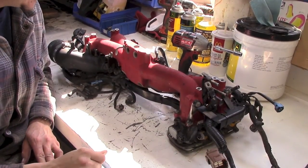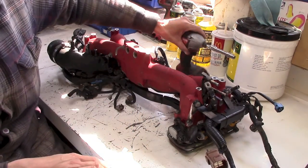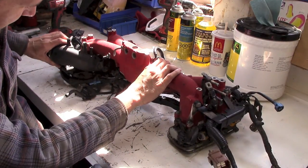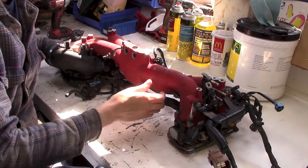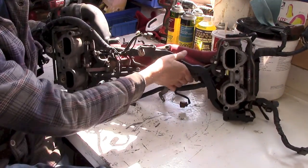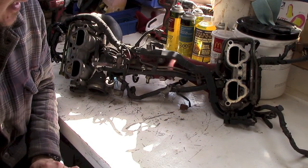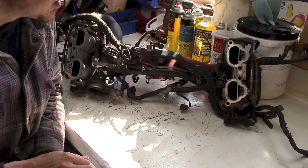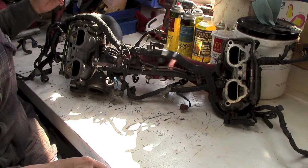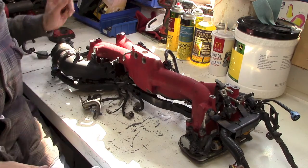But in this sitting, I am going to continue dismantling this because what I need to do is get the tumble generator valves out. Now, if you've been following any of my previous videos, you know that I'm doing a tumble generator valve delete so that I can get rid of my pesky check engine light. And the tumble generator valves, I don't know if you can see in the video or not, it's these spacer pieces. And there's some butterflies in there. I'll show you once I get it apart, but I've got to take all that junk out and gut it and make it happier. I've already done the tuning on the engine to get rid of the codes,